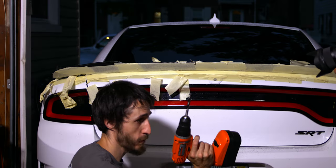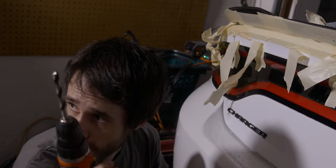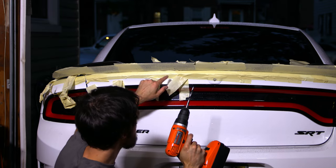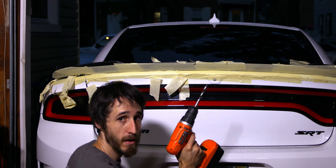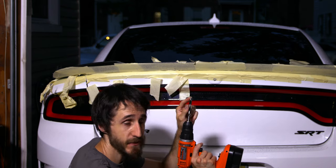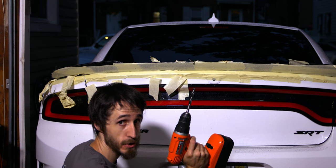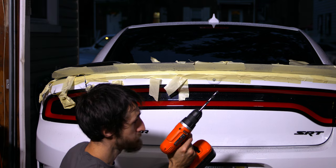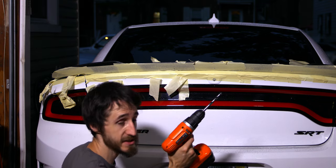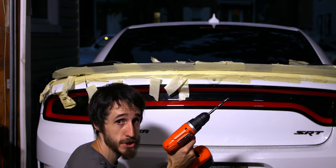Now I've got the 9mm drill bit here — this and everything else I'm using will be in the information box below. Because we centered the dot in the center of the hole on the spoiler that was pre-drilled, then we drilled our pilot hole dead center on that. This drill bit has a tip on it — I picked it specifically because this pointy tip is a guide to go in the pilot hole so you're drilling perfectly centered with the bigger bit, making your hole as close to perfect as possible. If your spoiler didn't come pre-drilled, you're going to drill the holes in your spoiler first — same theory either way.